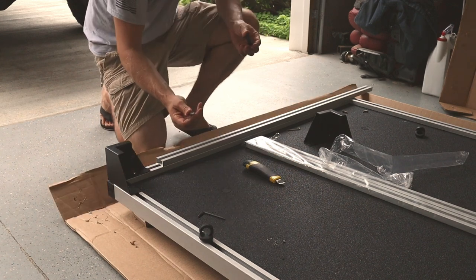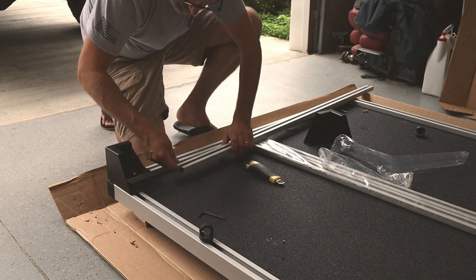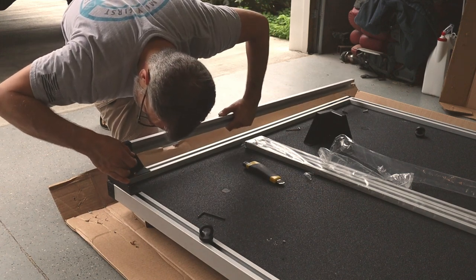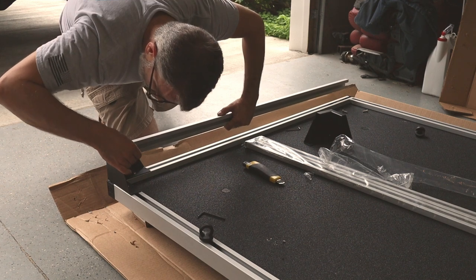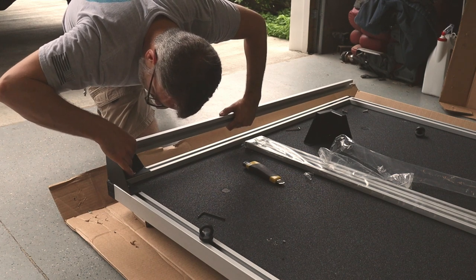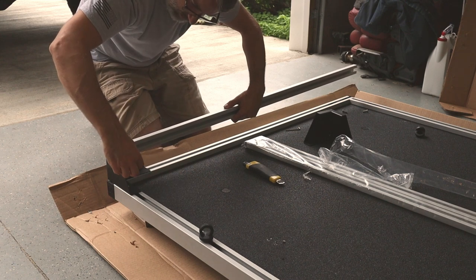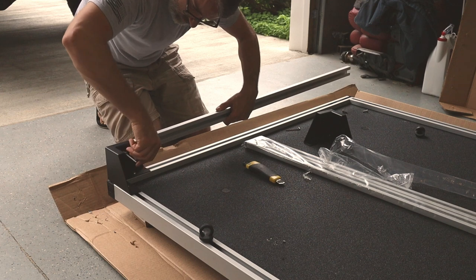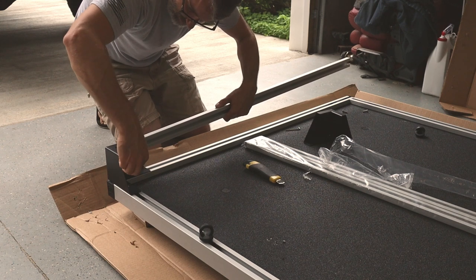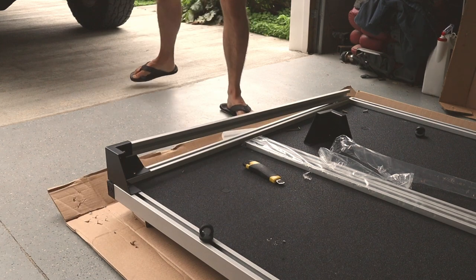So we start by taking our bracket and our Allen head screw. Again, we're going to put this in where the flat side is facing up. And then you need to set this inside here, like so. Get our screw hole lined up. Just like that. Get that started. I'm just going to run this down to the heads, just kind of sitting off the end of the bracket here. That way it kind of holds it in place. Like that. Alright.